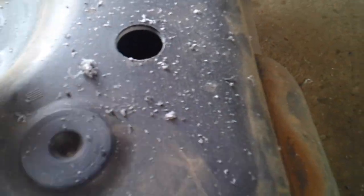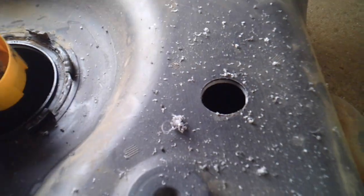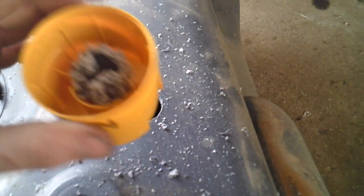The directions call for an inch and 3/8 hole saw. Just pick a spot on top of the tank and drill that thing right through there for your suction tube. I drilled the hole in the top of the tank, and obviously don't want this crap going in there, so I just put this underneath and held it there to catch the little piece as it fell out.